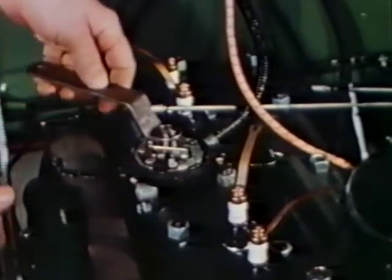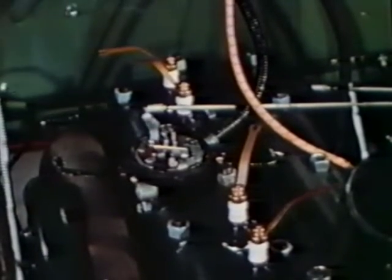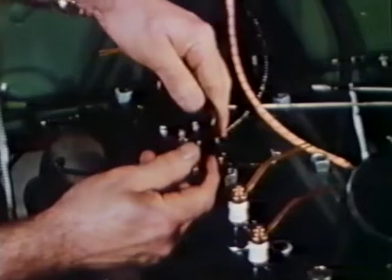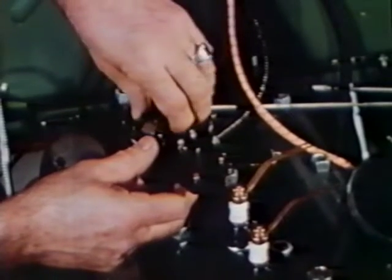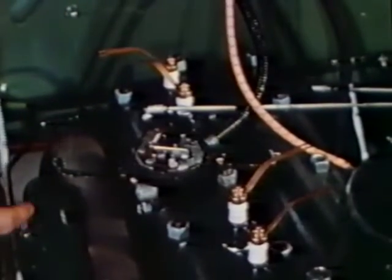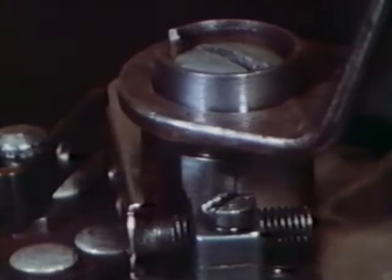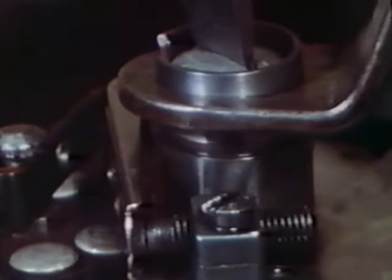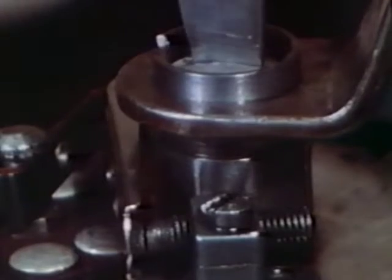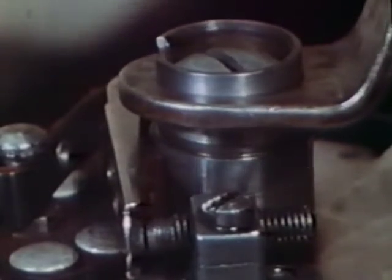With the cam screw loose, rotate the cam until the slot in the cam points to the number one contact. Unless you are really familiar, do this by temporarily replacing the distributor horn and set the middle of the flat brass conductor on the rotor to the number one contact on the horn. Now, the Model A firing order is one, two, four, three. I recommend the use of a cam wrench. Advance the cam in a counterclockwise direction until we can see that the points are just starting to open. Tighten the cam screw firmly. Our engine should now be in time.